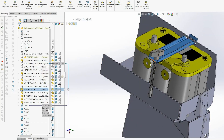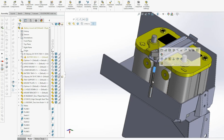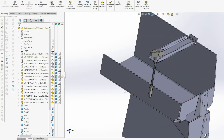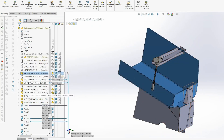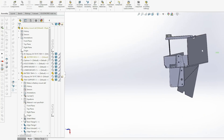We've got our Optima battery all mocked up in here. There's a hold-down strap, a channel piece, a coupling nut, some quarter-inch all-thread, and a knob to hold it down. That's how the battery sits and gets held down. The battery box mounts using a tray in blue and a mount plate — these will be welded together.